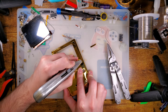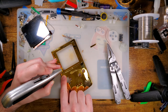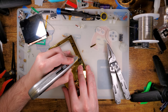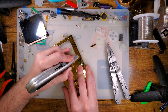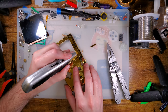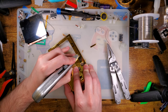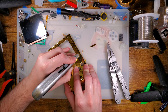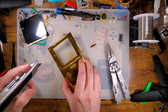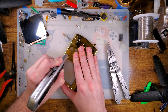One downside of scoring this on the outside is if at the end of your pull, you skip the knife out, you're gonna nick the side and it's gonna be very visible. That is why you only use a little bit of pressure and do several passes. It's much safer to do like 20 passes with almost no pressure than to do 5 passes with heavy pressure, because the likelihood of it slipping when there's no pressure is a lot less. Totally missed the line again.